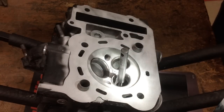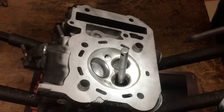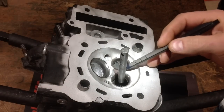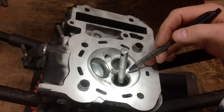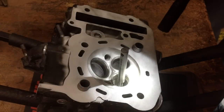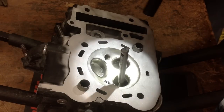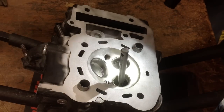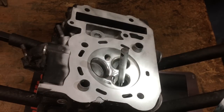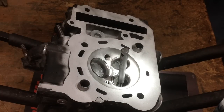I'm going to put my light on here. You can see the metal dust from the initial cut — see how shiny that seat is? This New Way system just does an incredible job of cutting that. Inspecting for a cut all the way around and that the width of the seat is proportionate all the way around. On motors that have more wear, the seat might look like it's been cut more on one side than the other, which happens when they wear more on one side. Be sure to inspect your valve guides if that's the case.